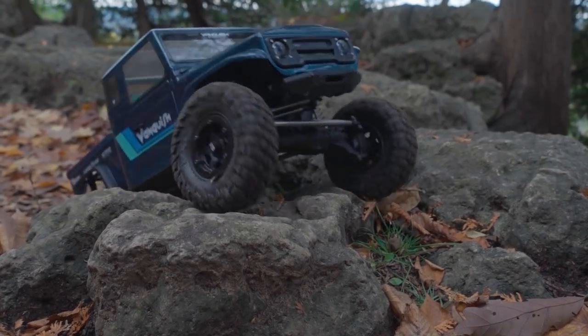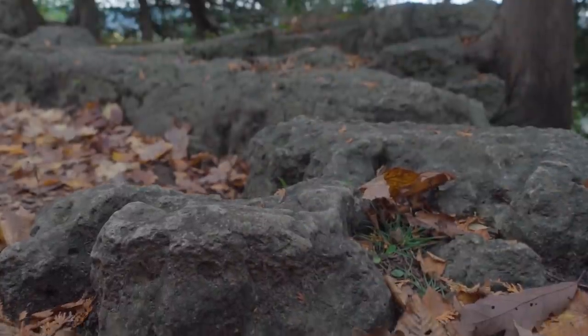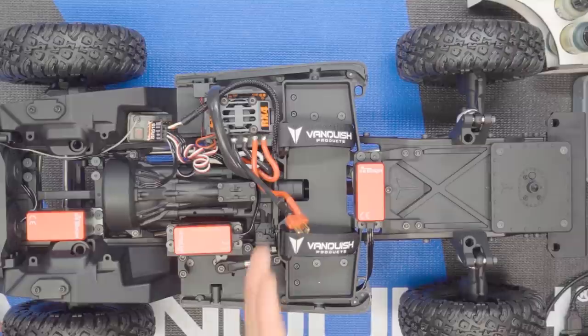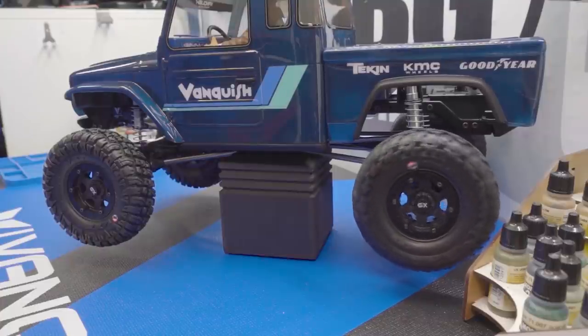More specifically, that is a 6.5% overdrive on our less aggressive one and a 33% overdrive on our very aggressive one. It is so cool to be able to do that. Not only have they got those two overdrives, there's also a middle section on that transfer case that allows you to run in a freewheel or a rear two-wheel drive only mode. So if you wanted to save gas on your regular highway driving, you've got that two-wheel drive option as well, and that's pretty neat to see.